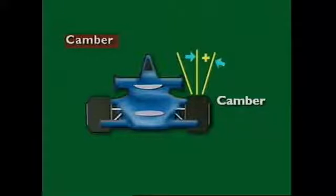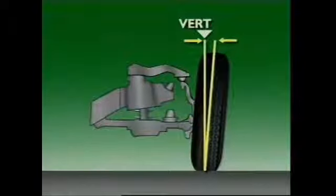This section examines camber. Camber is viewed from the front of the vehicle and it is the angle of tilt of the wheel from the vertical. A wheel that leans away from the vertical at the top is said to have positive camber; a wheel that leans towards the vehicle is said to have negative camber. On earlier vehicles with narrow tyres with a large diameter, large camber angles were used to bring the centre line of tyre road contact closer to the steering axis. It also ensured the vehicle weight was carried by the larger inner bearing. On modern vehicles, tyres are wider but generally smaller in diameter, and large camber angles would produce excessive wear on the outer edges of the tyres.